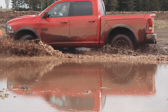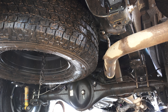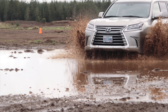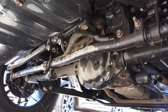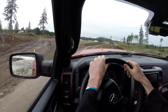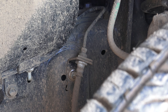The final point: if you have been off-roading, never leave without inspecting your vehicle — don't just drive home and assume everything's fine. From a safety standpoint, check underneath the vehicle before heading off. Inspect the underbody completely; check the tires for proper inflation and damage; check for visible body damage; make sure the steering linkages and suspension are intact; ensure the exhaust system isn't damaged; check that mud or debris isn't covering the radiator so your engine doesn't overheat. Also check threaded fasteners securing the chassis, drivetrain, steering, and suspension for looseness. Check for brush or plants caught in the vehicle — these pose a fire risk near the exhaust. If the vehicle and steering are vibrating, something may be caught in the wheels creating an imbalance. Finally, check brake and fuel lines for leaks or ruptures, and remove any abrasive materials lodged near them.